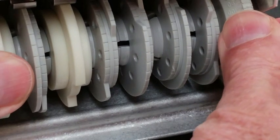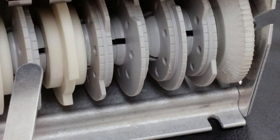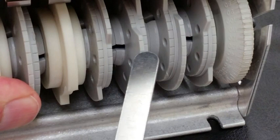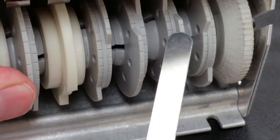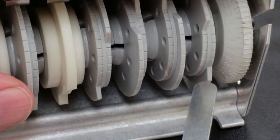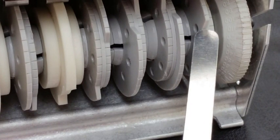So that's the setting of the cams. The fill cam is done first to tune the machine. Then we adjust the detergent cam once we have the volume of water figured out. After the machine refills after the drain, we bring in the sanitizer, followed by the rinse aid — adjusted by trial and error. Finally, the last cam adjusted is what we call the burp cycle: stopping the pump and letting air escape when water is back in the tank.